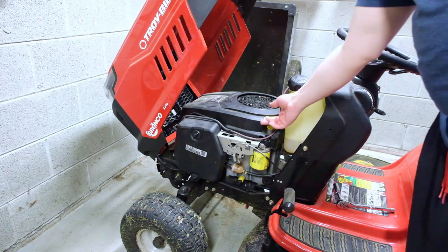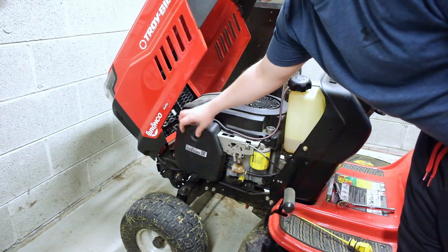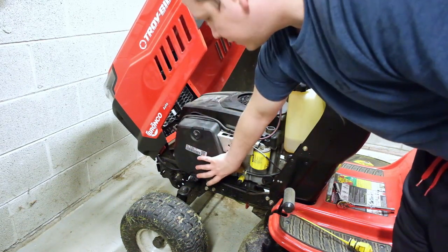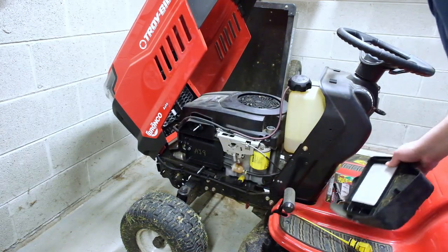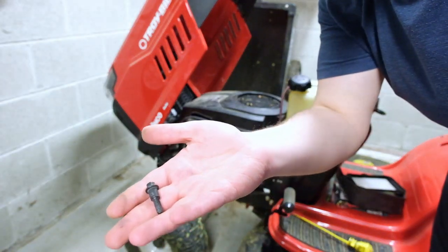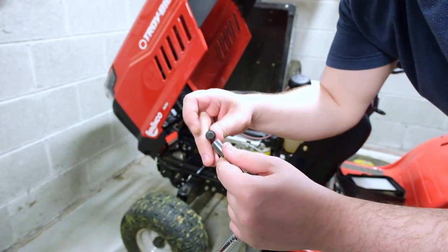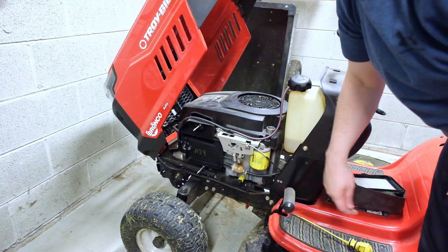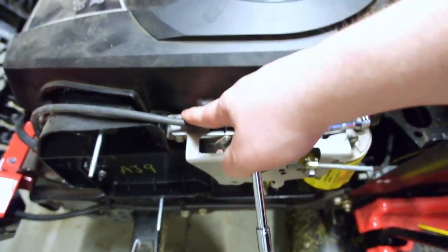So what we'll do — pull out the little oil dipstick there, set that down. We'll loosen up our air filter housing, which is just right here — we're going to replace that anyway. Just pull it off. It should wiggle free. Yeah, that was a little bit dirty anyway. Looks like that was about time to be changed. And then there will be four of these bolts — they are fairly long threaded and they are 5/16ths. There is one right here next to where you took out the oil, right above the oil filter. You've got another one hiding right back here by the fuel line.